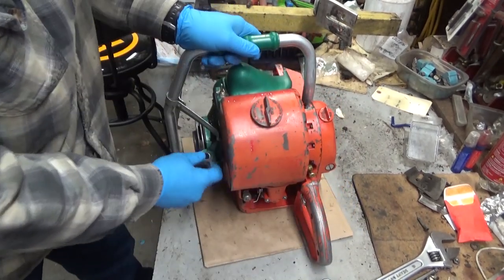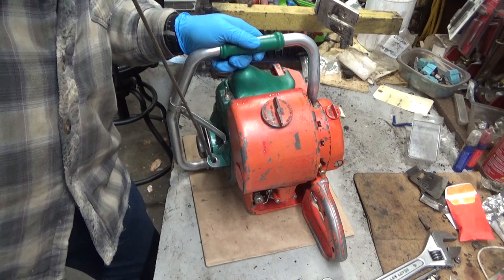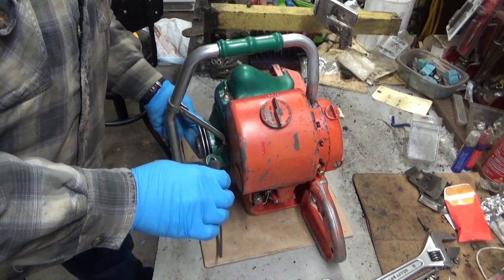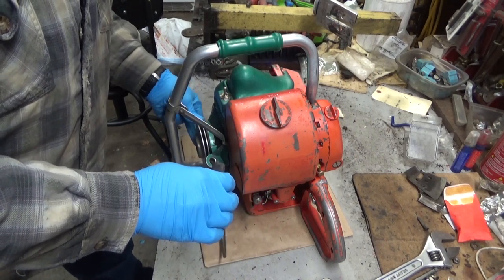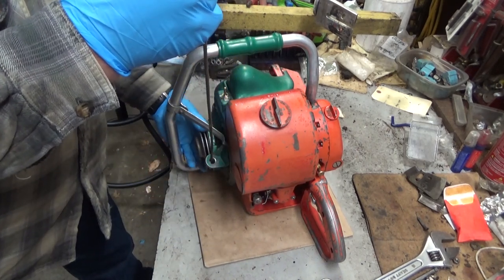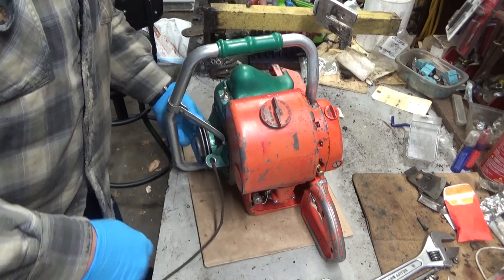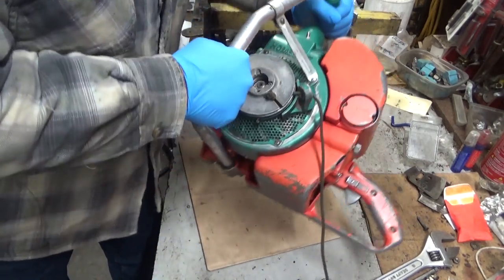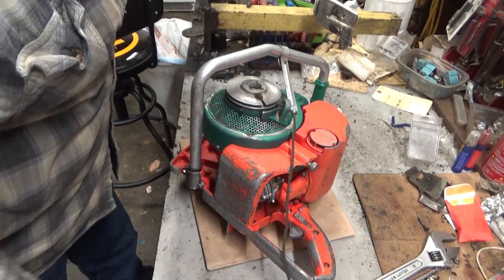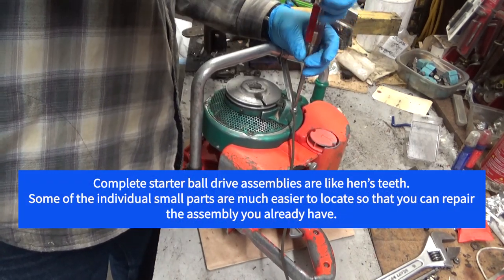Other problem though — isn't that compression? That's beautiful. Short rope. But this pulley won't freewheel in any one direction, and it should. Because if it started right now, it's not going to release — it's just going to rip the rope and probably break this starter. And these are probably the hardest thing to find. So let's get into this real quick. I want to see what we're up against, and if I need to order some parts, I'm going to do it.